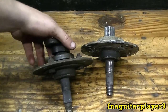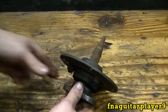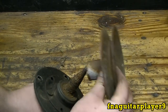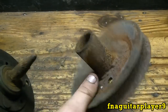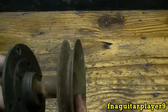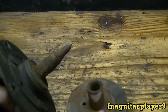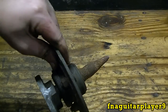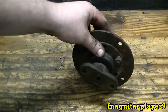First I'm going to show you another quill assembly just like these that came off of them — have you ever seen this happen to one? Right there is what it's supposed to look like, and this is the pulley off of it. What happened — you can see even the splines are gone off of it, completely wallowed out the pulley. The nut came loose on top and it just started getting loose on the shaft and ground it to a point. First time I ever seen one do that. If that happens, you definitely need a new quill assembly. You can get the shaft by itself, but if you're going to buy that you might as well just buy a whole new one.